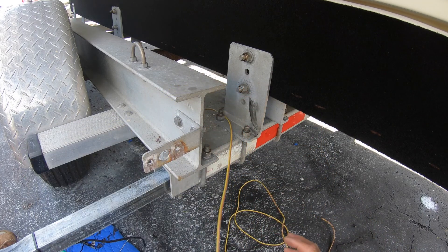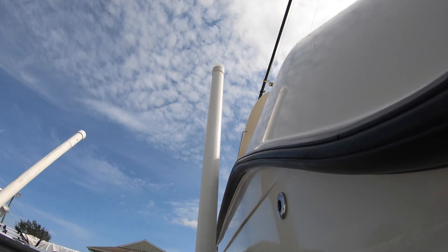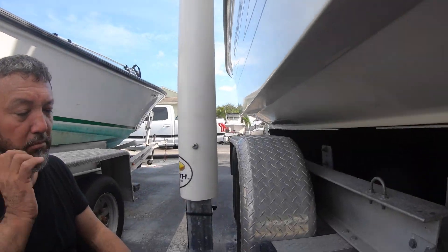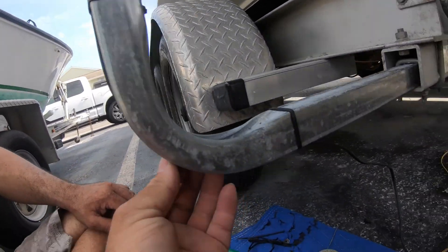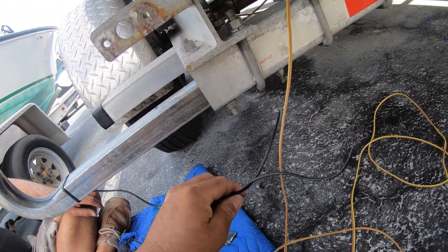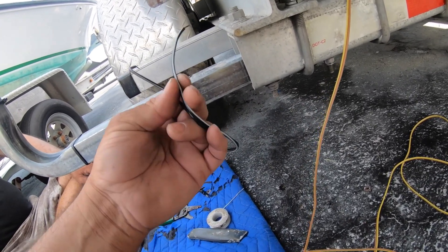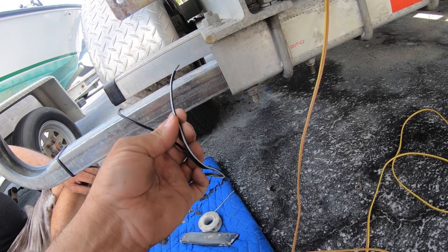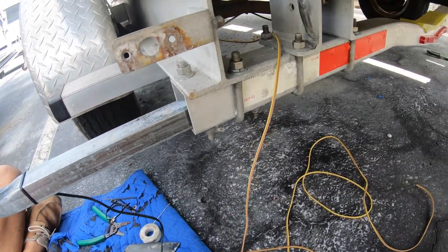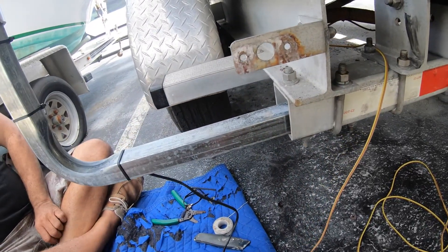We are adding one extra thing: LED indicator lamps. The forward side is amber and the back side is red. We've run the wires down the channel on the outside, and we have the two wires here. Because they're LED, they are positive/negative sensitive. On this brand, the black wire with the white tracer is the positive and the solid black is the negative, so we need to install it correctly onto our harness and grounding wire.